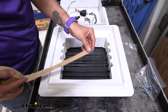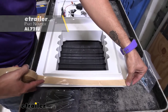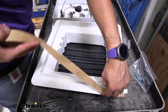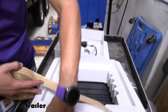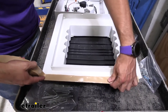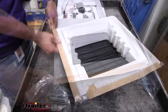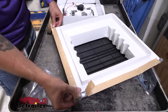The first step of our installation is going to be putting some butyl tape onto the top portion of our vent — this is your cover that has the outside portion. We're going to go around the outer edge because if you look you can see these little indents where your screws are going to be going through into the roof of your trailer. We want to get that nice and snug up against our flange so that we don't have any water leakage, making sure we're fully covering where our screws are going to be poking through.